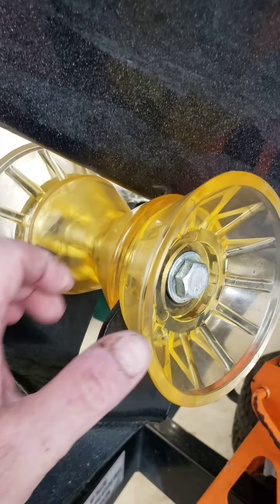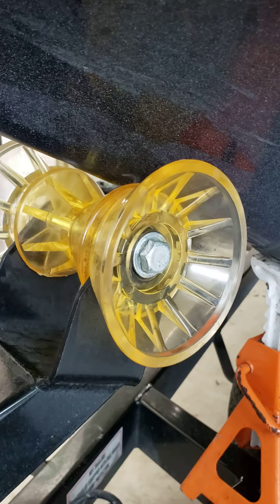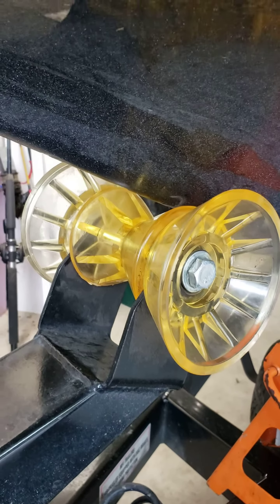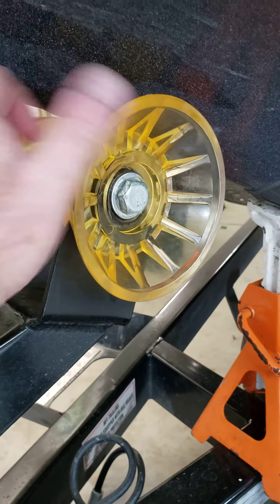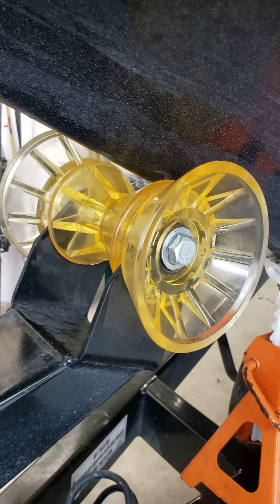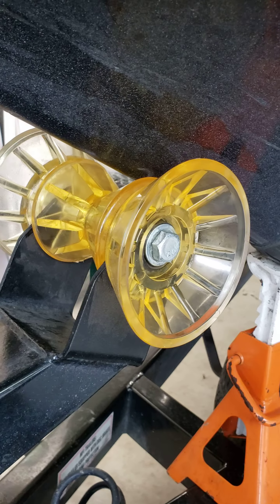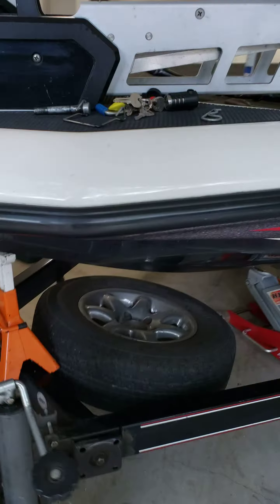When you put this on — I'll tell you what I did in a minute — make sure this thing rolls right. Don't crimp it so tight that it's done, because these won't roll. It'll bump along until it gets here and then start rolling, which makes getting the boat on the trailer much easier.